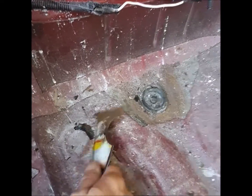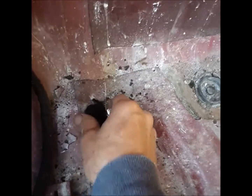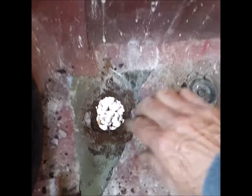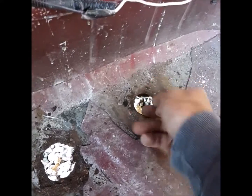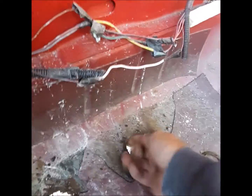This one isn't too bad — the hole's still there, but sometimes these will get water under them so when you bring the sound deadening up it may be all rusted out, or it may be fine. This one doesn't look bad at all. Yeah, see — it's rusted out right there. That's how the other side started, so I'll cut this side out too. I'll check this one — this one's still in there really good, so that one should be fine. Get it all sandblasted and treated.